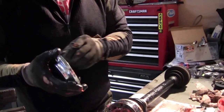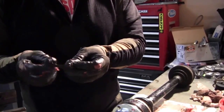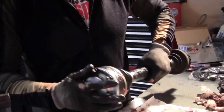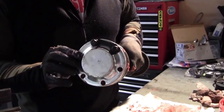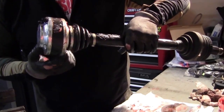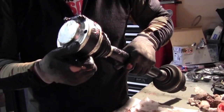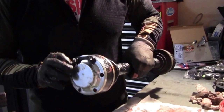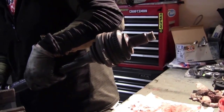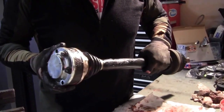We've got new caps with the kit. Put the caps on and line up the holes. What I did to cheat was I took the differential Torx bolts, put them in the holes, and pushed them through — that way I was sure to get my holes to line up. Then to get these sealed, I just put them in my vise and ever so gently ran around and squeezed them together. Depending on your CV joint, these may go on easily or maybe they won't — mine I just wanted to press them down so they were secure. Once that's done we'll go to the other side; it's going to be the same process. Thanks — tune in for the next episode. I'll be doing some more E36 M3 repairs. Until next time, thanks guys.